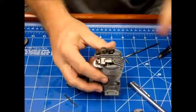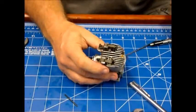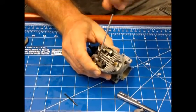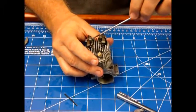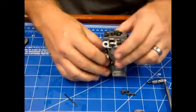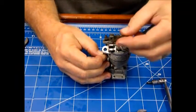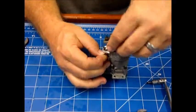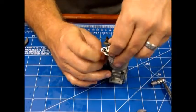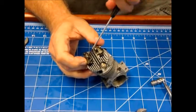Since I'm going old school with this, I'm planning on running it without the valve covers on — it'll look kind of cool. I just have to make sure I get that pin tight enough so it doesn't work out during operation, because one of the things the valve covers do is ensure these pins can't come out. There's no way that pin is going to slide out if the valve cover is retaining it. I'll take this one off, find my tapered end and make sure that goes up, seat this in down here, make sure it goes into the cup, and reinstall the pin.